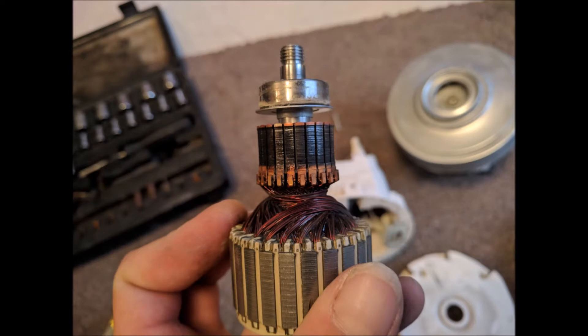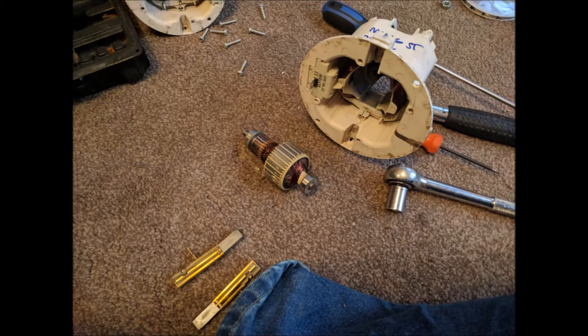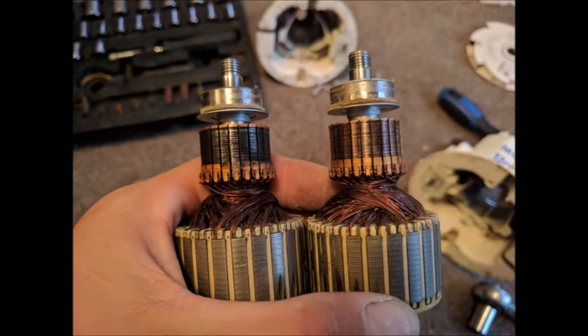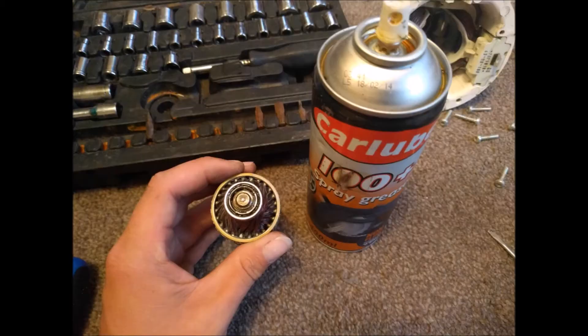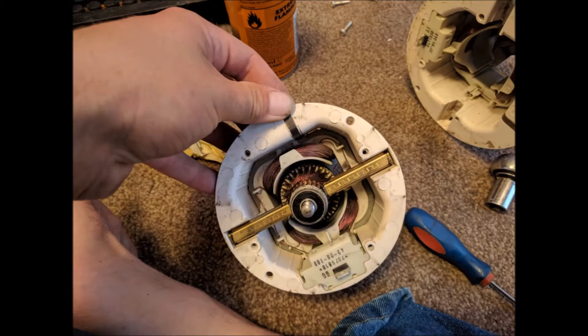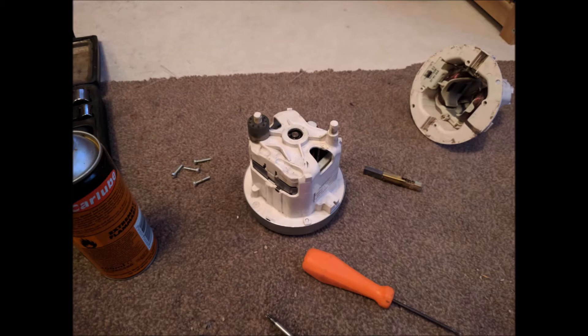Let's have it apart anyway — and wow, that's burning out of that one. Mystery solved. The size issue was a spanner in the works, but I had a thought: I stripped the S5-980 motor down and had the armature out. It wasn't exactly the picture of health itself, but did run, and was exactly the same size, so it could be swapped over. The carbons on the left are from the S7, and on the right from the S5 — they are a different length though. I greased up the quite-seized bearing from the S5 armature using spray grease, but did have to use the S7 carbons as the S5 ones are longer. I thought about breaking out the sides of the motor so they could be extended, but thought there might be an issue with electricity escaping, plus I'd have had to tape stuff around and make it safe. Done and back together. I found the missing rubber belt still fit into the housing after taking this picture.